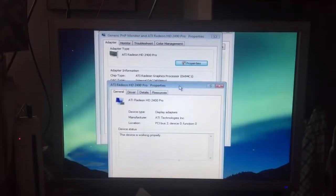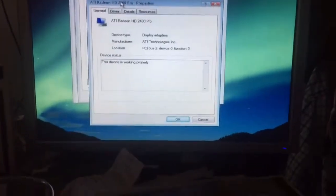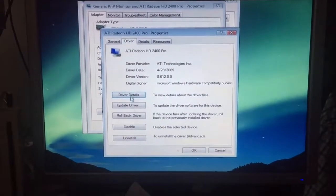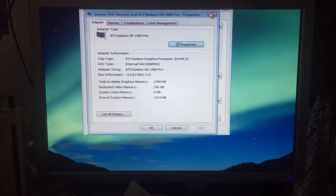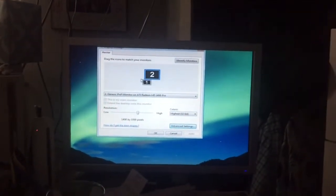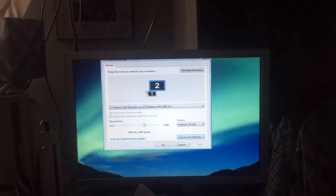Click Properties and this will show your graphics card driver. If you're still having trouble where it was just mirroring the two monitors, the software may not be updated enough — you'll need to click Properties, then Driver, then Update Driver. That's how I was able to get the update. I had to restart Windows and then it figured out there were two different monitors, so I was able to set them up for dual display. Now I can have YouTube on one and browse the internet on the other. That's how you install your graphics card and get it working properly. I hope this helped — check out our channel for more how-to videos. Bye for now.